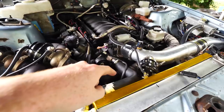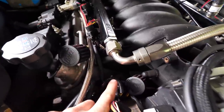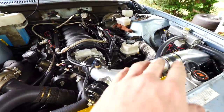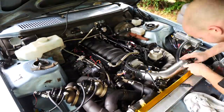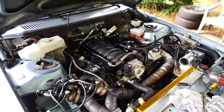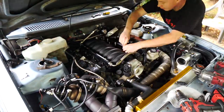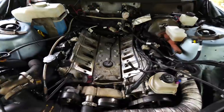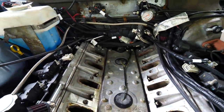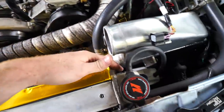The crank pulley is all done. Now we have to move on to the steam port kit. In order to install that kit — the fittings are right down there — we have to take off the intake manifold. Unfortunately, so all of this stuff has got to go. Now you can see these are our steam port kit fittings, and there are two ports that are blocked off in the back of the head. It's just a simple matter of installing the fittings, routing it up, and then we'll have to drill and tap the radiator.